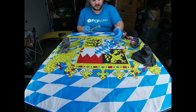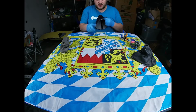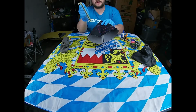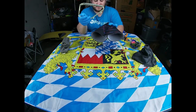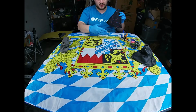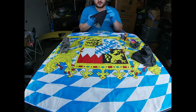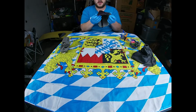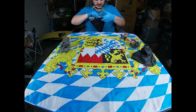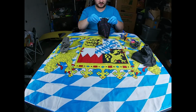Okay, so this is one of the real complicated parts, which is easy for some, but basically you want to just get your boot. And you'll have the French stitching. That's designed to go forward, to face the driver. Honestly, you can do it to the side, to the back, to the front, whatever suits you. But since this would be the back of the car this way, I generally have the French seam that we add facing the driver, so it looks a little more aesthetically pleasing. So what you're going to do is get your frame and flip it upside down here, and get the frame pushed up in there a little bit. Sometimes if you set it down like this, it works a little bit better.